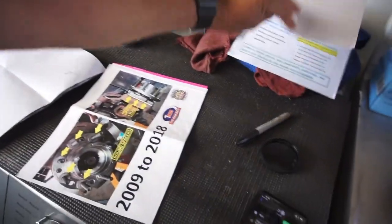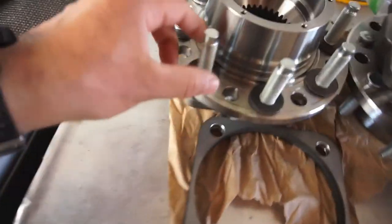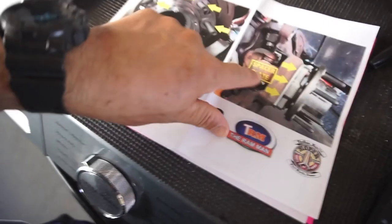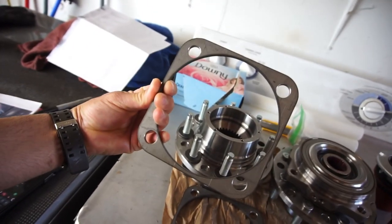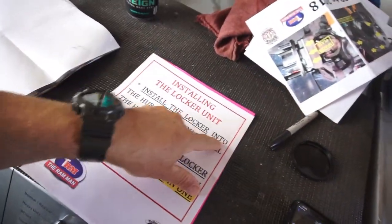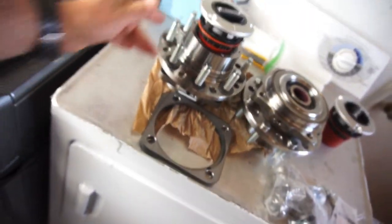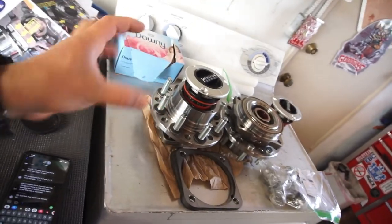There's my receipt. Round spacers — they look like washers but they go on there. The spacer plate goes between the knuckle and the wheel bearing. Install the locker under the hub before you install the hub on your truck — basically install this onto here before you put the wheel bearing on, so it slides in one piece, because apparently people are messing it up somehow.